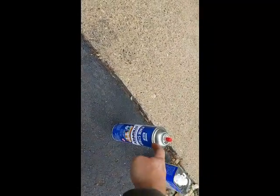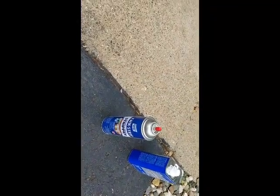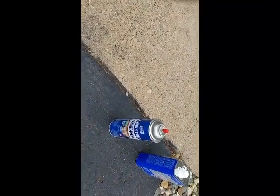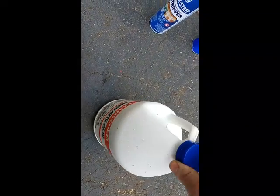Clean Strip Quick Strip Fast Paint and Varnish Stripper. When I was done with that, I left that on there for about 20 minutes or so, and finished up the bare metal with the muriatic acid. Once most of the paint was off, hit it with muriatic acid and scrub it down, pressure wash it again, and then I'll strip off the rest of the rust and paint and prime it.